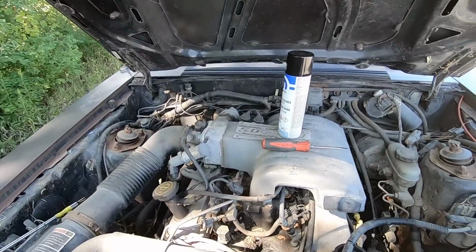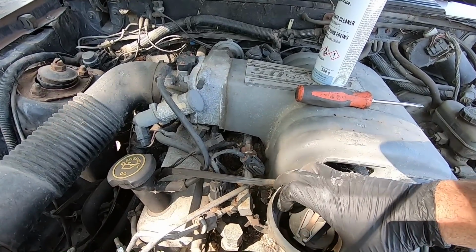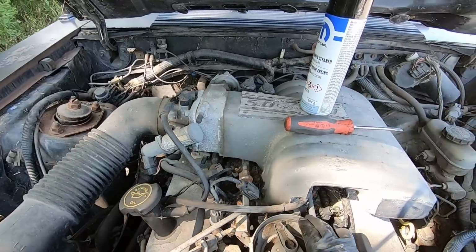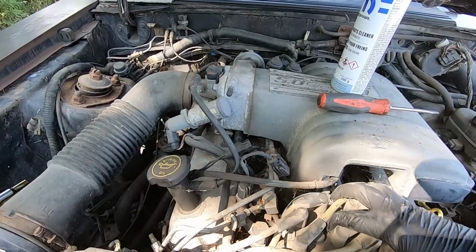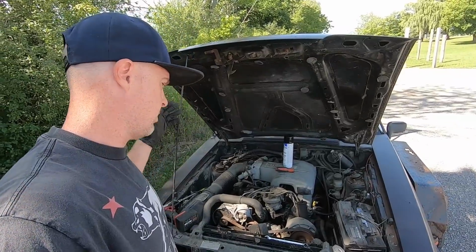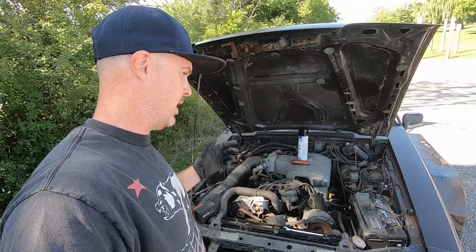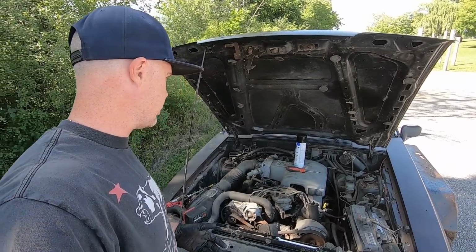So now we'll go ahead and put our distributor back in. I think it's pretty much right around where it was. Yeah, facing number 1. So we've gone ahead and taken care of the basics. We got some oil movement. There is oil. And now the next step is going to be to see if this thing will actually crank over with its starter. God knows how original it is.